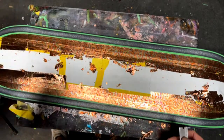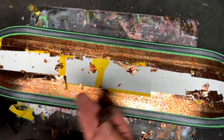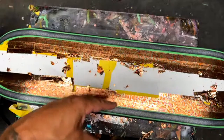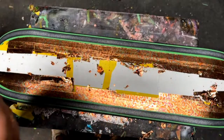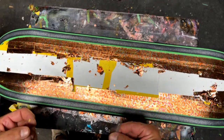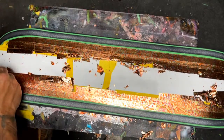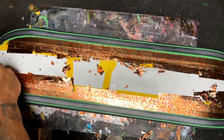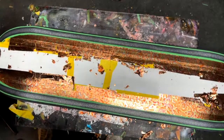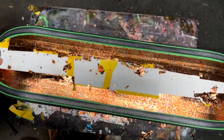So once I hit this with clear coat, I'm going to hit it with a light coat at first. It'll give that first layer of clear coat time to set up so it can bond, before hammering it down and creating a really thick, dense layer that you're expecting to just lay on top and adhere. It's better to do very light coats at first so you can get that grip. It will also help with running. Those tack coats, as we call them, a light coat at first, will definitely help with that and a lot of the other contamination problems we've spoken about earlier.